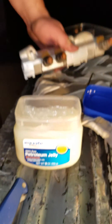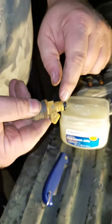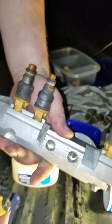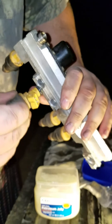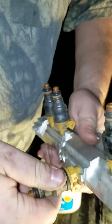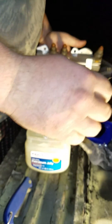At this step of reassembly, take some petroleum jelly on top of the o-rings — not too much, but just enough to help it slide into place and not get boogered up. I am not using the little clips back on it; the bolt should be sufficient enough to hold it in place. Make sure your injector electronics are pointed towards the outside as the wiring harness has to plug in. Give it a wiggle and push, make sure she's seated in there straight.